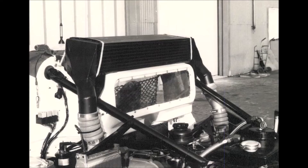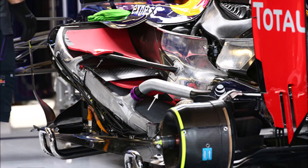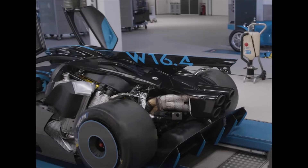In addition to that, their radiator net volume is bigger and also the intercooler pipes are much bigger, which is a packaging issue. So they tried to package the biggest possible intercoolers at the side. It looks like it wasn't possible to make them any higher or wider, so it looks like they made them as deep as possible.